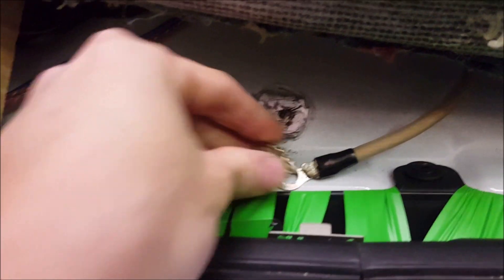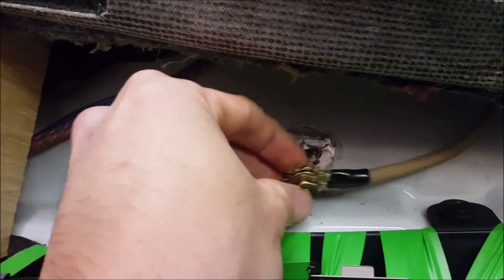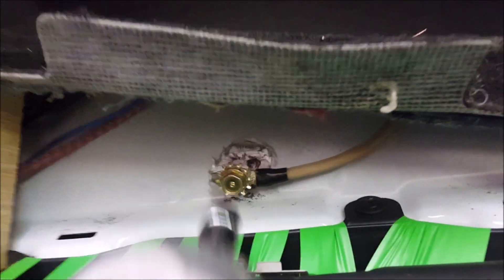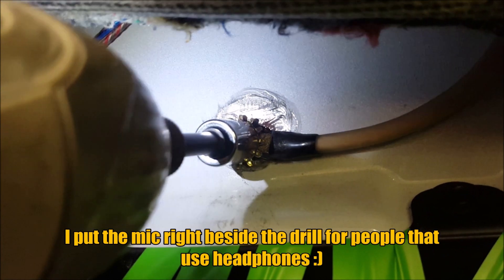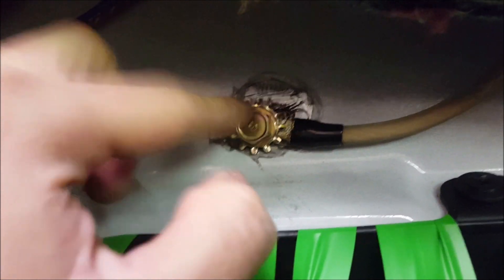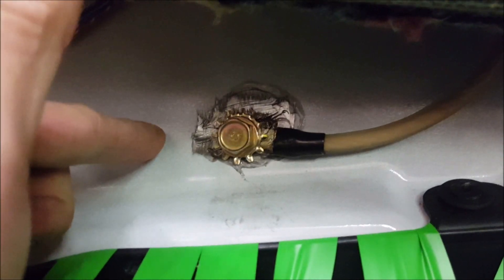Final step — you have to pound in the bolt. Put the lock washer onto the bolt first. You want to have your ring terminal flat up against the metal at all times. If you watch my How to Ground an Amplifier video, you'll see that this bolt will actually flare the metal out and self-thread itself. It's not a self-tapping bolt, that's why I have to drill the hole, but it will self-thread. If you think the sheet metal is too thin, go ahead on the other side and add a nut to it.